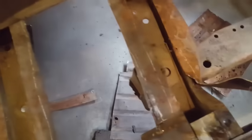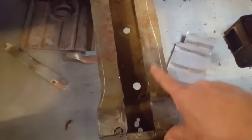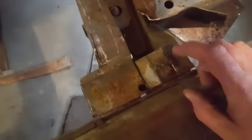I got the pans all cut out, as you can see. Now I'm back to solid metal. I got to cut along here on top of the cross members. I got to remove these sections here now, take a chisel to them and work along till I find some spot welds. And it's heavier steel underneath, so it should break clear from the top, and then I'll just clean it up with a grinder.